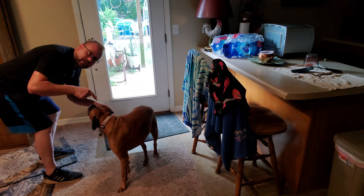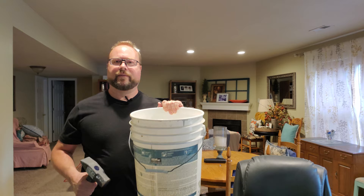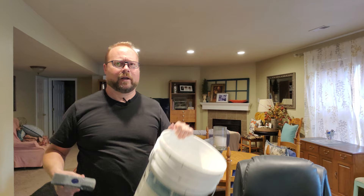Some of the other stuff we're gonna need is a hammer — I've got a sledgehammer here, which is good. You can also use a dead blow hammer; it looks like a rubber mallet but it's got sand in it, so they work pretty well. You need something with a big head and some weight to it because we have to knock the shock out of the base. I'm going to try it with a five-gallon bucket so that the shock can drop in and have something to steady it on.